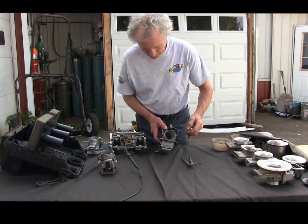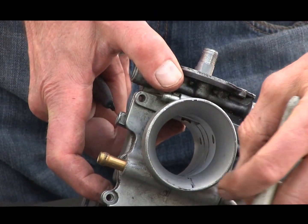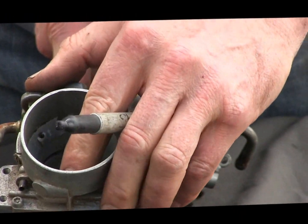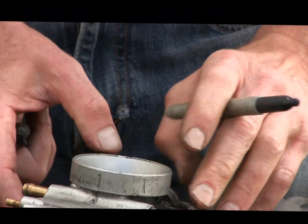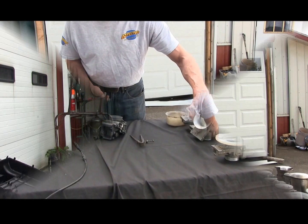If you look at the bell — nicely shaped bell — you'll also notice the ridge in there that I'm saying not to sand or roll. That's to start the air. Just like on this carb on the Mach Z, that tube starts the air to get to your flare. And if you look at any of the crank shops, real nice air bell, rounded.